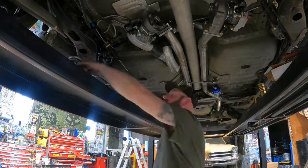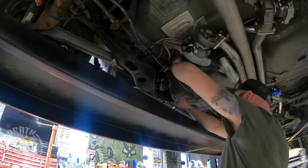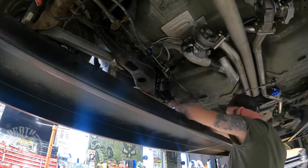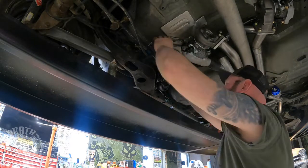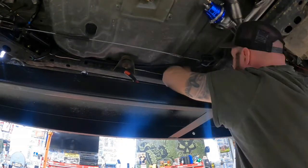Here I am running the line. We just did steel brake line. You could also use quarter-inch copper — it would work just fine for an oil pressure line and may actually be easier to work with. You can get that at a hardware store.